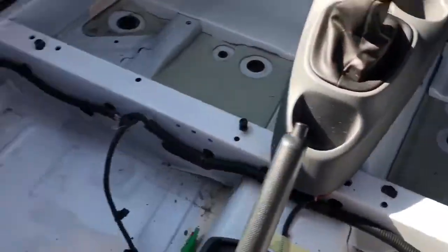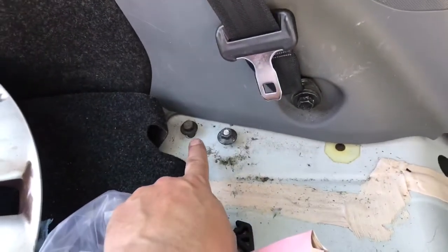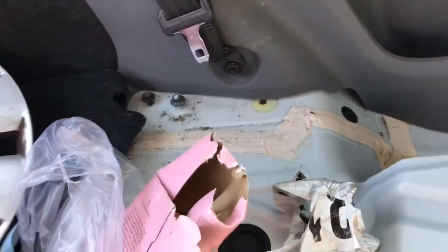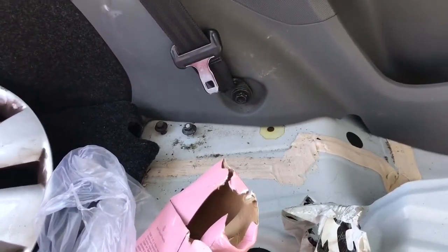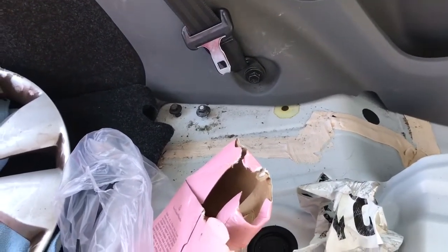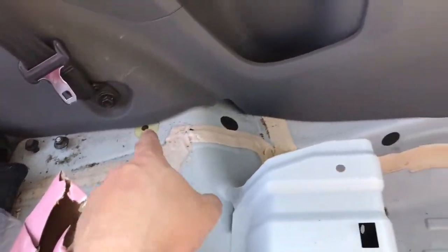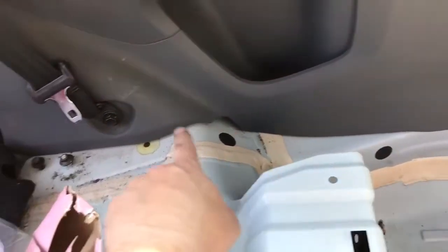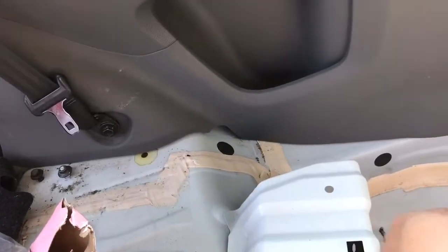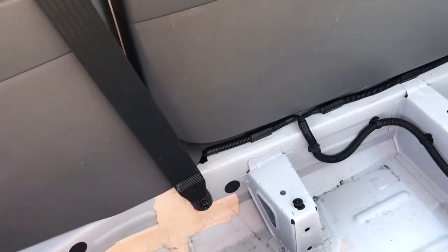The rear seats came out quite easily. Fold the back down and you can access on both sides a 12mm bolt and a 12mm nut - they come off both sides. The back then lifts away, the front tilts up and it's a little bit of wriggling - lifting upwards, pushing downwards and sliding forwards with the base to get it out. That comes out quite cleanly along with the carpet underneath. The carpet's not actually attached underneath this side panel, so at this stage I'll just pull it free and once the conduit is clear from the clips, that comes out clean as well.